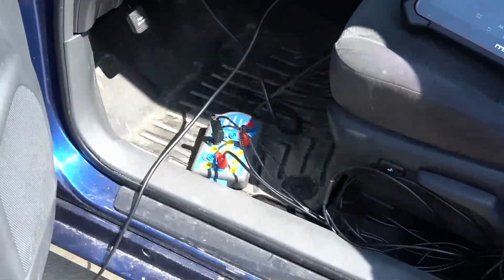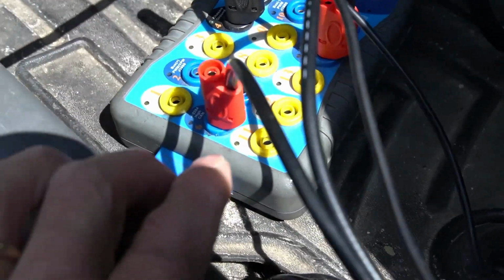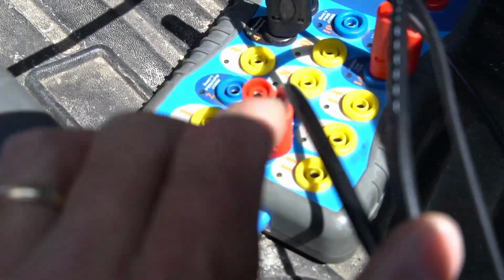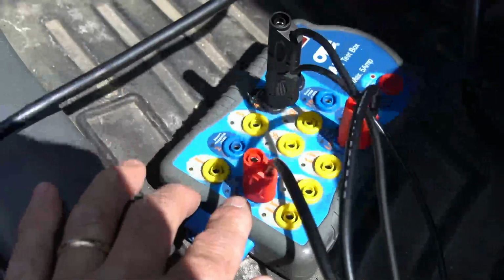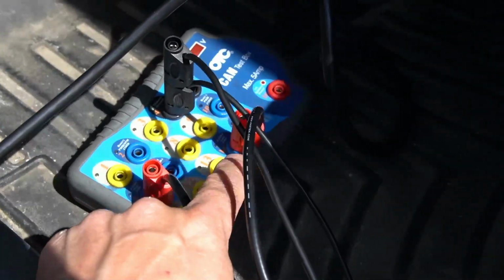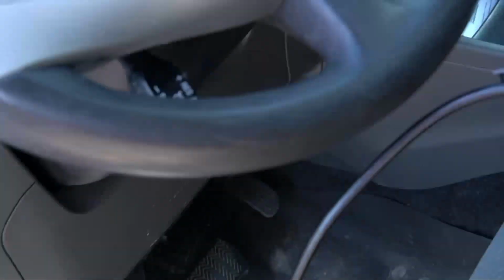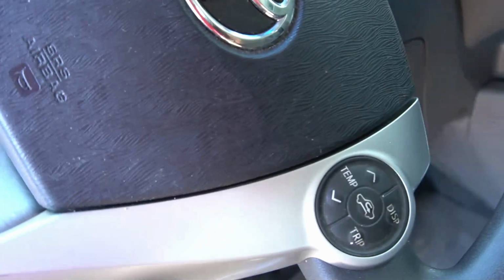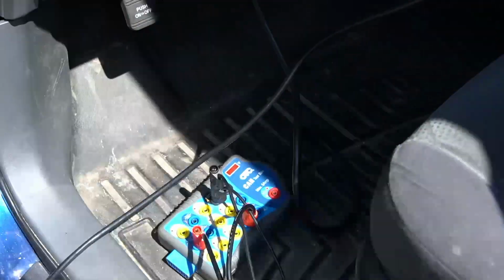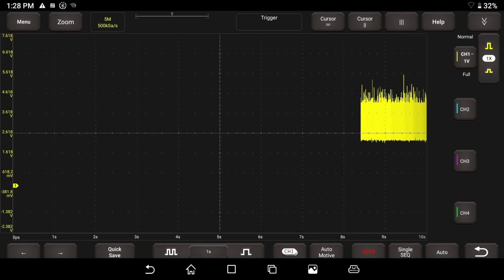All right, everyone, we are set up on a real vehicle here. Our channel 1 is going into pin 6 of our DLC. That is CAN high. And channel 2 is going into pin 14 of our DLC. That is CAN low. So I'm going to go ahead and turn the key on here. There we go, and we've got our scope on. All right, I'm going to go ahead and hit the run button. You see we've got a capture going on.